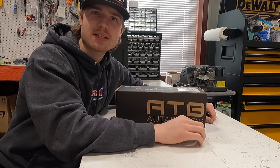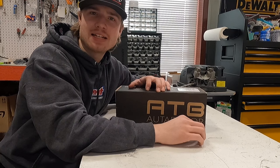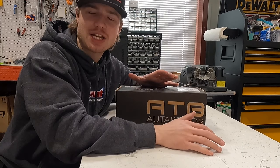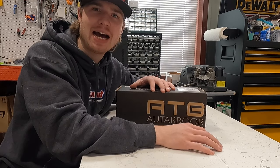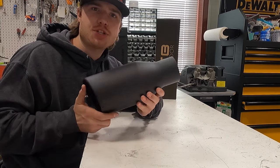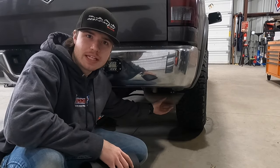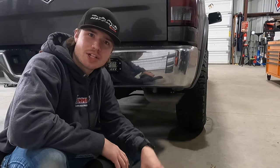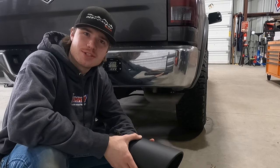It's now a couple days later. I ended up deciding to order an exhaust tip. We're going to get this thrown on there and see if it makes a difference to the sound. I'll put some videos back to back so you can really tell the difference. I mainly just did it for the look, but I think we might get a little bit more echo and a little different tone. This is a good old Amazon special — I'll throw a link in the description. It's a three-inch to five-inch tip. First thing we need to do is adjust the angle of the exhaust — it's tilted up a little bit. I'll go under there, crack the back clamp loose, and tilt it back down level so we can fit this on with no issues.